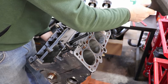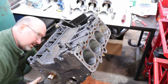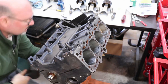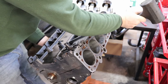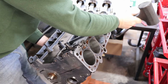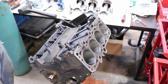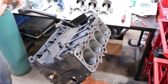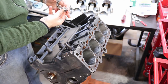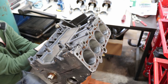Now I've got to push it down a little further so I can grab the connecting rod and guide the connecting rod over the crankshaft. Then I can put the bottom connecting rod bearing — the connecting rod bearing cap — on, making sure I line the numbers up.